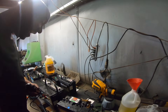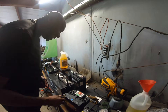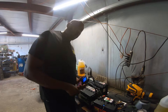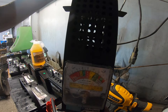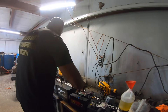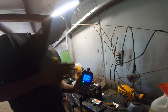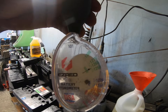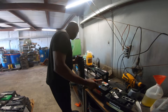We've got two more batteries to complete this process. Another Everstart, two years old from May 2022, original CCA of 590 - now reading 639 cold cranking amps. One more battery, three years old, original CCA of 700 - now reading 800 cold cranking amps on a three-year-old battery. We were able to bring it up higher than the original manufacturer's label. Hydrometer is in the green at 1275, and the load test is holding strong at 12 volts.